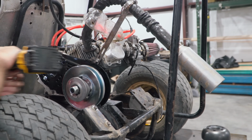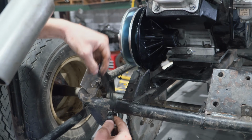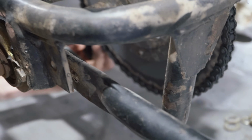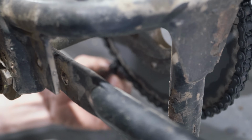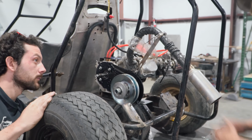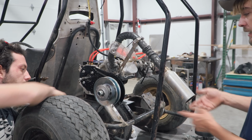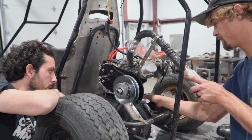Click. Click. We're good. Okay, so not much shorter. Not much length at all. Can we get by without doing a half? Oh, yes. Try and put the master link in and shove the engine forward to see if it... Whether we move the sprocket left or right, this is the right chain length. Go ahead and tension the engine now, just to double check.